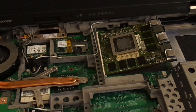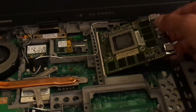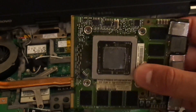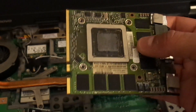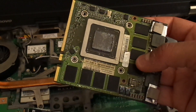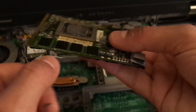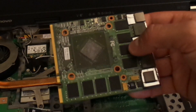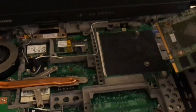If you need to be mobile yet have all the power to use high-intensity, resource-heavy programs, this is definitely a great way of achieving that. This is the old GPU that was displaying all of the vertical bars and distortion on the screen. Again, this is an NVIDIA FX 2700M, which only has 512 megabytes of dedicated memory. We're going to put that to the side and now install the new MXM2 NVIDIA FX 3700M, which uses one gig of dedicated DDR3 memory.